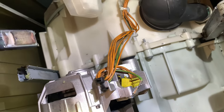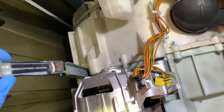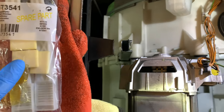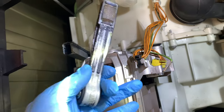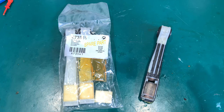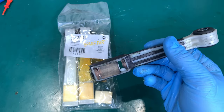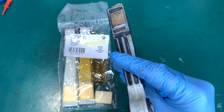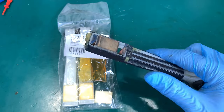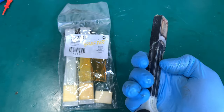You only need to remove one screw — one bolt — you pull it out, put the replacement in, and bolt it down. That's the fix. The replacement was so simple I couldn't believe it. This is the shock absorber that was broken — you replace them in a pair. It has something similar to a sponge that creates friction.